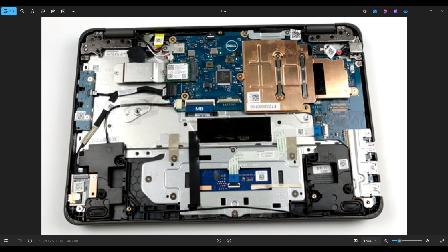If you're here to reset BIOS, you don't need to take that battery up — you can leave it down. Just unplug it from the motherboard right here. Leave it unplugged for maybe 15–20 seconds, and that should be sufficient to reset your BIOS system settings. Don't pull on the wire — you can break it out of the plug. Just use your fingernails or a pry tool and wiggle that plug out of that port.